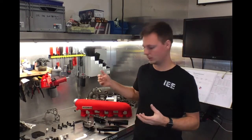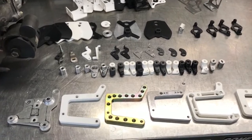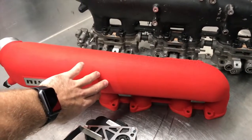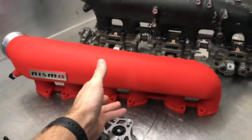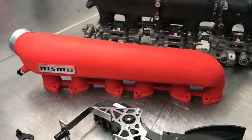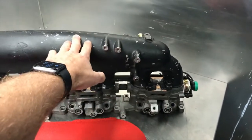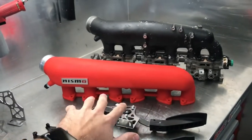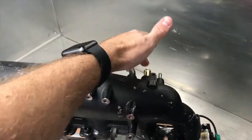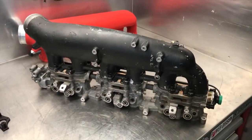Behind me we've got the entire system with the pedals, so we'll take a look at that now. Here we have just some examples of the prototyping work involved — the Nismo intake manifold that we have milled down and prepped to use without the throttle cable bridge, which would normally go here. That's one of the cool things about this drive-by-wire system: you can remove all the unnecessary bolt holes on the intake manifold to give it a really clean new look. You can also remove all the pipes and hose connections at the bottom of the manifold because you don't need those anymore.